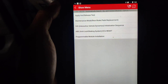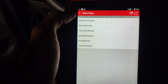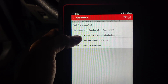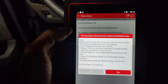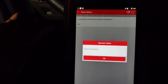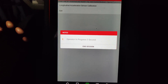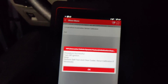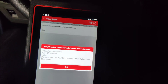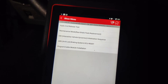Okay guys, I found it. It's under special functions under the RCM. You go under special functions and it's under this 'interactive vehicle dynamics sequence.' Then you press yes, and now look — longitudinal sensor calibration. Turn the ignition on, we're on. Man, this is kind of a pain to find — it's definitely not laid out real easily. Procedure successful! Are you serious? That's all we had to do.